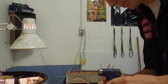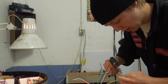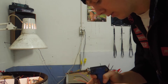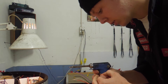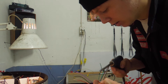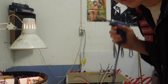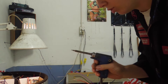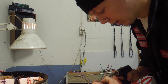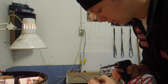You'll snap the wire before that comes out. A lot of people like to twist and then solder — not highly recommended. What can happen is you get air pockets in the centre where the solder hasn't gone all the way through. You're actually better off just holding the two together and soldering them next to each other. The good thing about this is that if you ever need to redo something you can just untack it and re-tack it. Whereas when you twist it, it's really hard to undo without cutting out the whole solder joint itself. This really is the best way to do it.